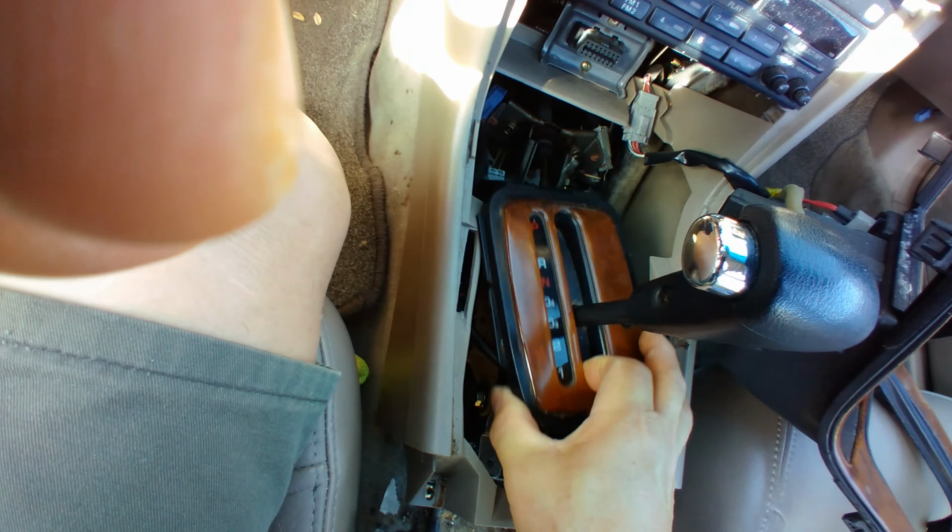and the light is underneath. It's near gear number 1 and 2. So all you do is push it up, there's some room. The cable is okay. All you do is turn it, counterclockwise, and it should come up. Okay, counterclockwise turn and pull it out. That is.